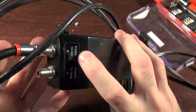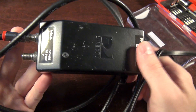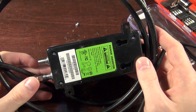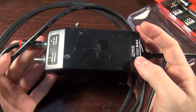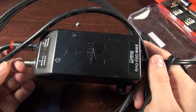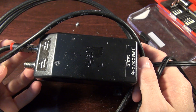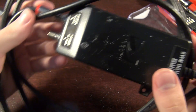Signal to IRDs, power to SWM — what the heck? We could pretend I know what that is, but I don't. So this is for powering the dish. You put this in line between your cable box and the dish that goes outside, and this provides the essential 21 volts of power it requires to run at all. If you don't have it, it does nothing.